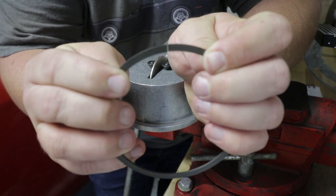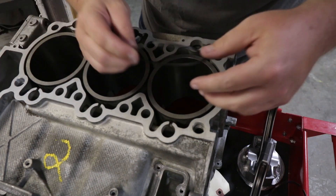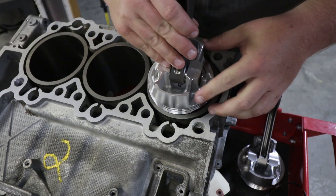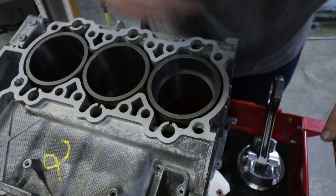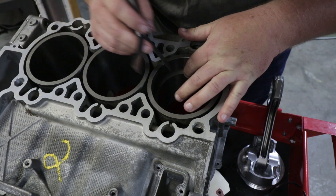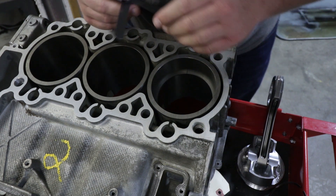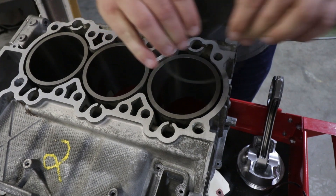As you can see, it's still nice and square, which is what you want. Back at cylinder number one, put this in, square it up, and let's check it. We're good. If anything, I may have done one or two turns too many — the feeler gauge isn't quite as tight as I'd like it to be, but it's pretty much right there. I'll keep that in mind next time. That's the top and second ring done. Let's take a look at the oil control ring.